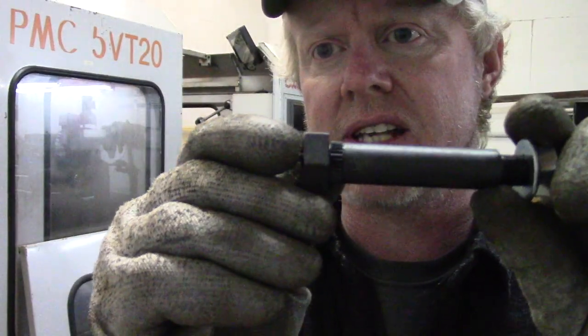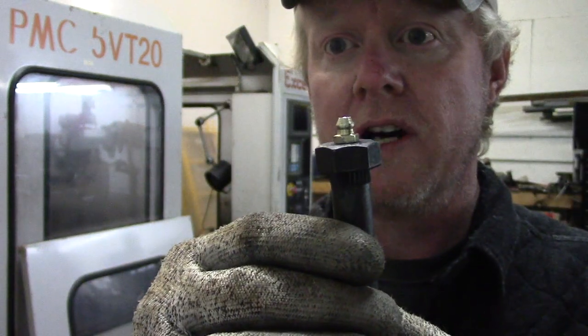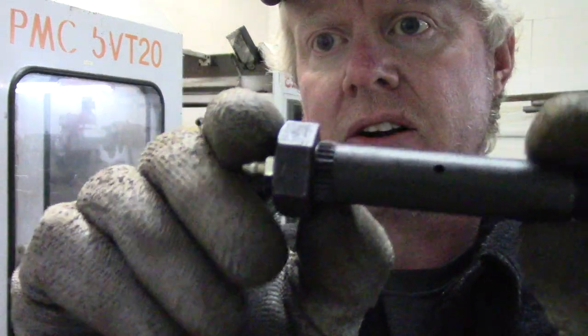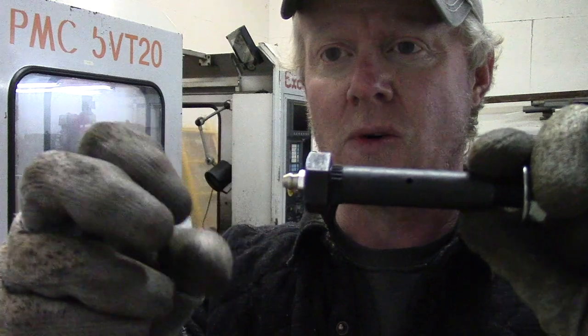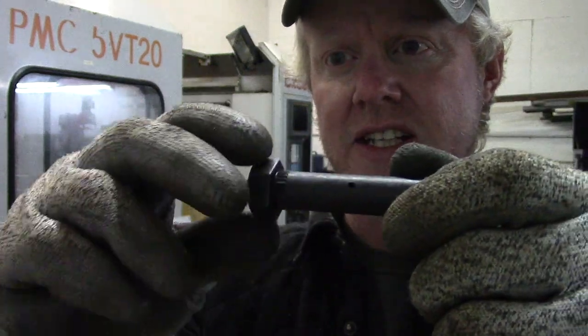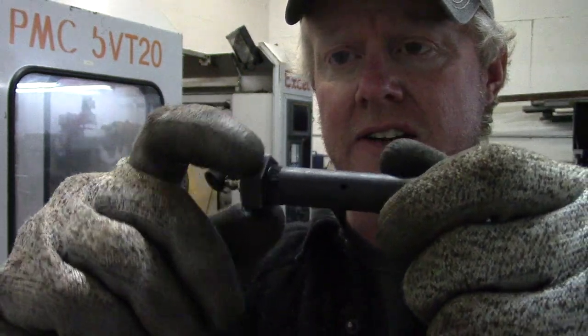We're back at the shop - actually it's the evening. I picked up an axle and it took about four days to get to me. I bought a whole new axle and new springs. This is a wet bolt kit - same bolt we had trouble getting out. On the bolt head side they usually have serrations that get pulled in. I had to put a nut on one side and use the air ratchet in forward and reverse to work it loose.